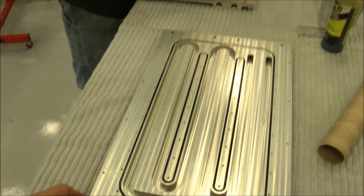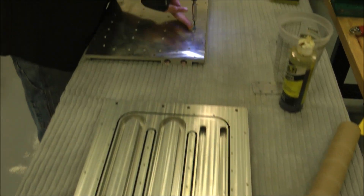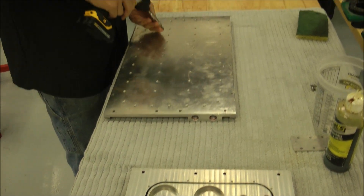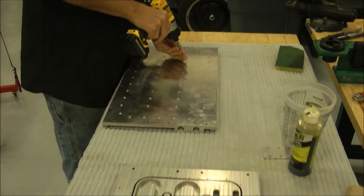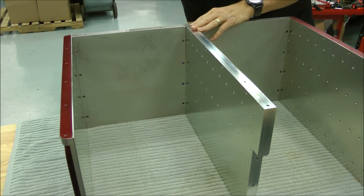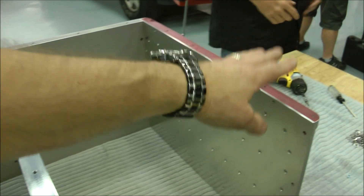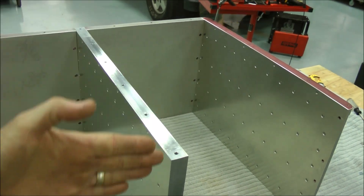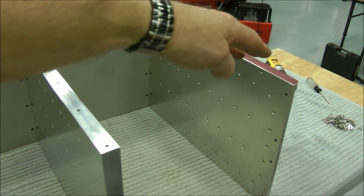Jack has installed O-ring gaskets — they're going to be used as part of the water cooling system to seal it. This plate is exactly like this one, and he's screwing down the cover so it'll compress against the O-ring gaskets and give us a water-tight seal so the liquid can circulate. That's how the cooling plates work. These three cooling plates will have all the cells standing up in this direction, conducting heat out through one of the three cooling plates.